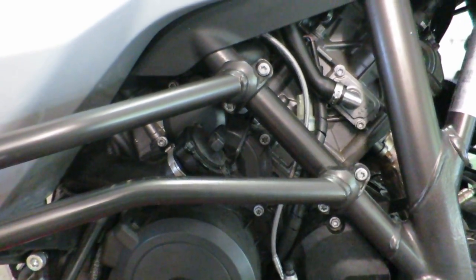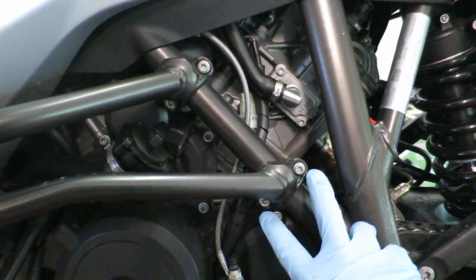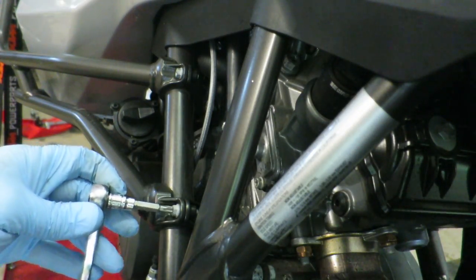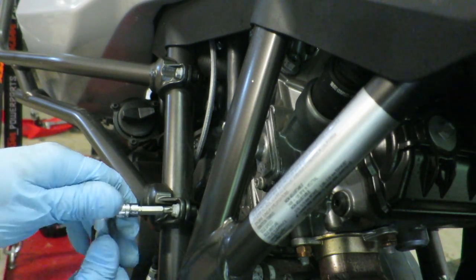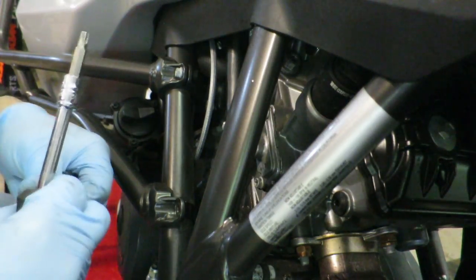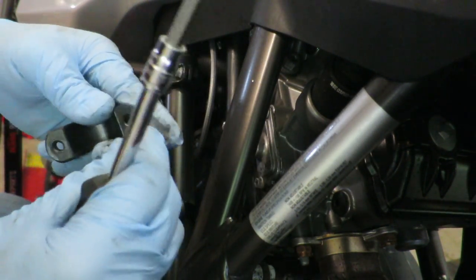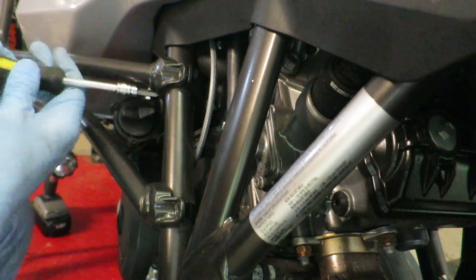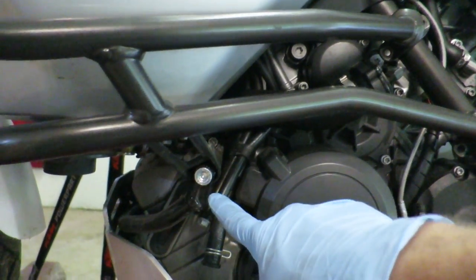Be careful, there is a nut on the back of these. Over on the left-hand side of the bike, the next four screws to remove are these two and these two — these are the clamp halves. We're back to a Torx head here, the same size as the one used to remove the windshield. I'm going to thread these back into the bottom half temporarily so I don't lose them. With those four screws and half clamps removed, the last thing we have is right here — and we're back to an Allen, 8 millimeter.